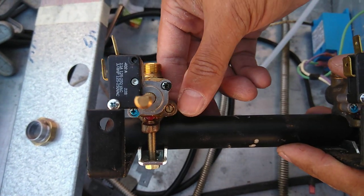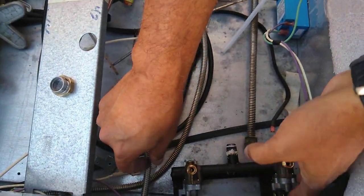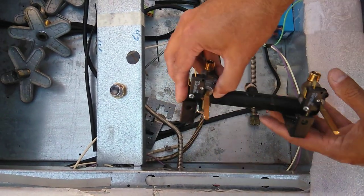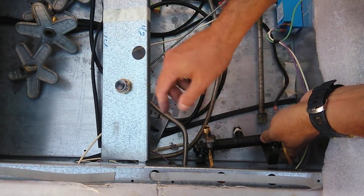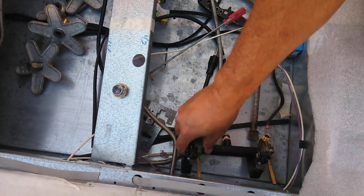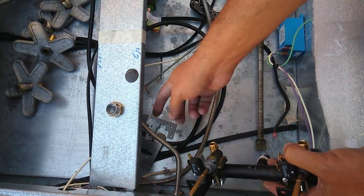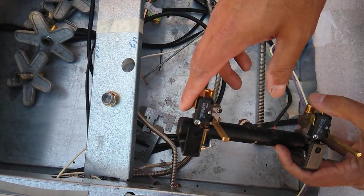The gas comes out of the valve, goes into a long line going to the burner head, and that gives you your low flame capability. When you turn past a certain point it enables gas to shoot up a tube at full throttle. If there are two jets, it goes through a second orifice and out through the burner head. That is what a low flame jet is.